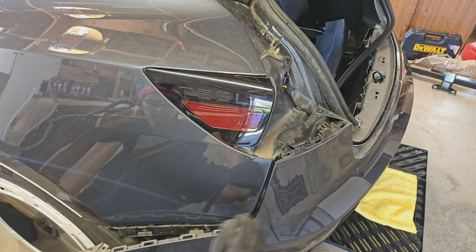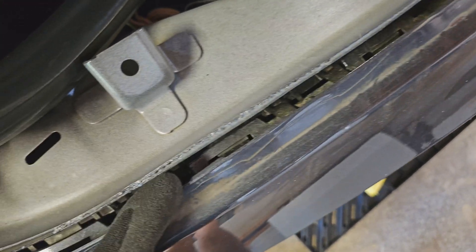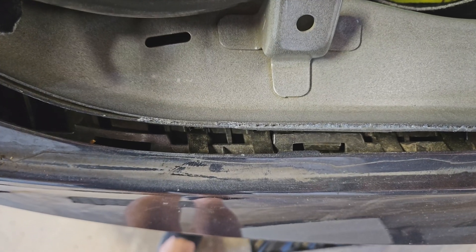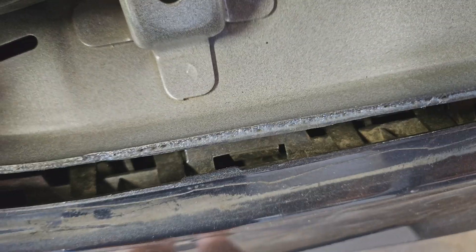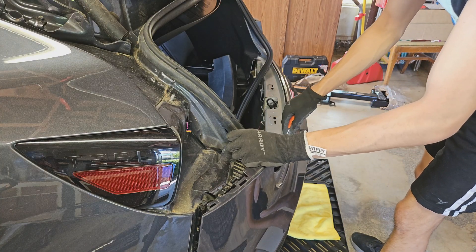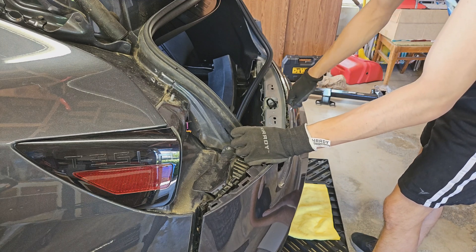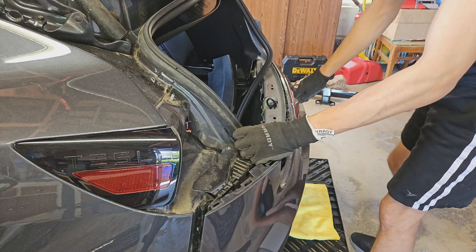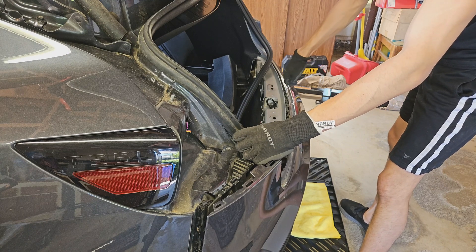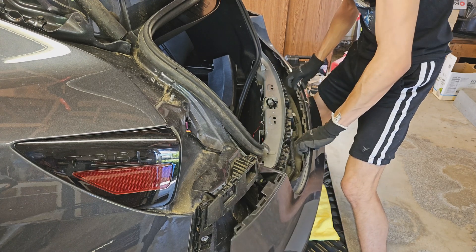Pull a little more from the bottom side — now that's totally off. You can see there are also these black clips — be careful of those when pulling this off. You'll want to start from one side of the bumper. Once you ensure that part is off, take out your 90-degree pry tool and gently use it to pry up against those tabs. Pull it upwards while pulling the bumper back towards you, and that will release the clips. Do this the entire way of the bumper. Be careful, because once you do this, it's the last thing holding the bumper to the car — so it will fall. Use protection. Always use protection.